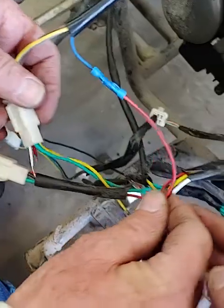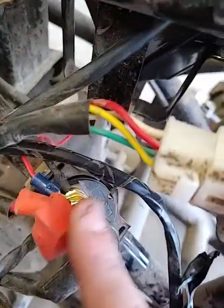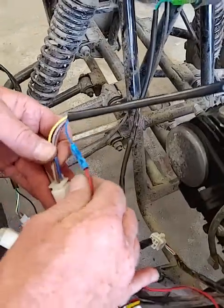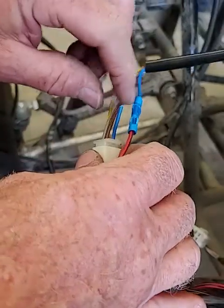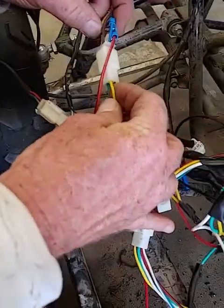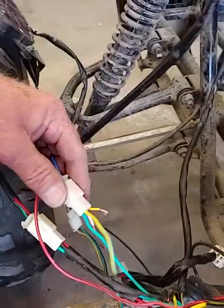The blue wire has to be connected to a positive source, so we used a red wire and that goes straight to the positive post on the solenoid. That's going to the start button — the blue wire on your start button, you're going to splice a piece of wire and run it to the positive on your starter solenoid. Then the brown wire, which is the other wire on the start button, is going to the activation wire on the solenoid — it provides the juice to activate the solenoid.